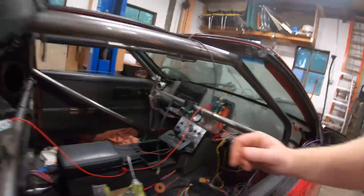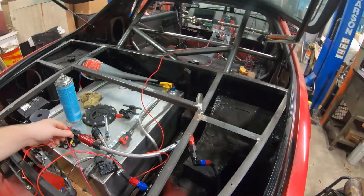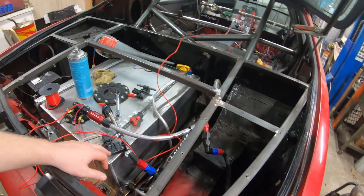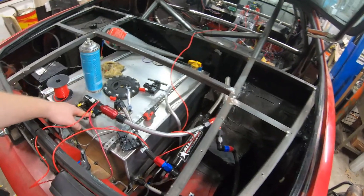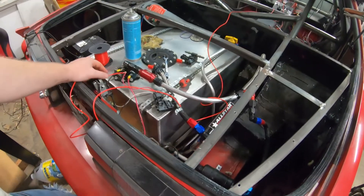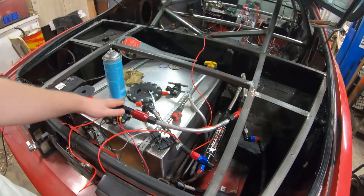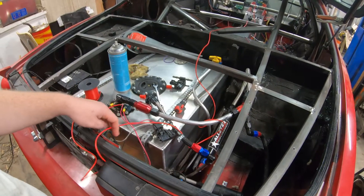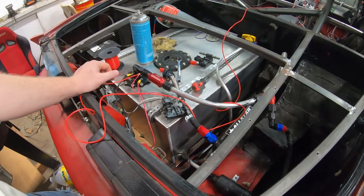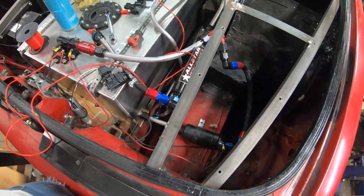Up here we have a lot of wiring I was doing for troubleshooting — I wasn't sure if I was getting a proper reference line to my flex fuel sensor, because I had it originally hooked up where the fuel pump was. I'm going to run this permanent and have that tied to the key so whether or not the fuel pump is on or off, it will always work. I want the flex fuel to come on with the key on, along with all the rest of the ignition system.